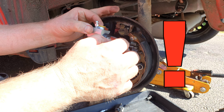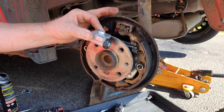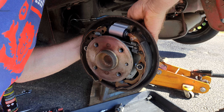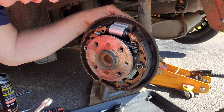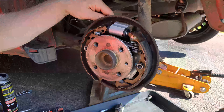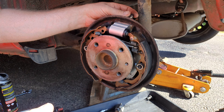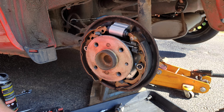A few precautions to observe when putting the new one back on: remove the bleed nipple and put that in afterwards. Remove the bung in the new one that comes in the brake pipe union hole. Carefully slot it back into place. Put the securing screw in first, then gently position the pipe into the hole and start the union nut by hand for at least the first couple of turns if you can, and then tighten down. Good opportunity while you're here to get a little bit of emery cloth and clean the small section of exposed pipe as they do have a tendency to rust because the pipes are steel. Return your bleed nipple. If there's any danger you might have got any dirt or grease on the end of your pipe before you put it back in the cylinder, give the end of the pipe a little spray with brake cleaner, but make sure to allow it to dry off thoroughly before you put it back into place.